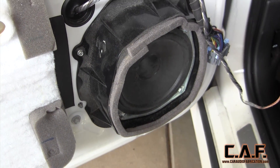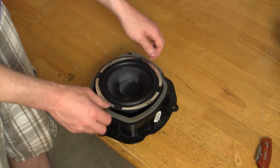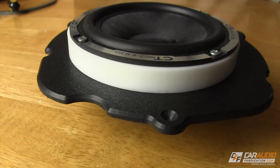What Kevin is asking about is how to finish off a custom speaker adapter. If you're not familiar with speaker adapters, let me give you some insight. Oftentimes in a car audio install, we want to install a speaker into the doors, but unfortunately we often cannot fit our nice new aftermarket speakers into the OEM location. The speaker might be too big or too small for the hole, the mounting depth behind the speaker mounting surface might not be deep enough, or there might be a window that comes down in the way. So we have to add a spacer that not only adapts the size of the speaker, but spaces it away from the mounting surface so that the large aftermarket magnet doesn't hit anything inside the door. For this reason, we'll oftentimes fabricate a custom speaker adapter ring to solve these issues.